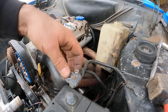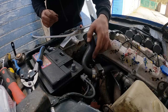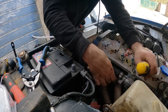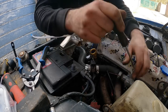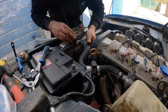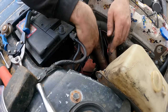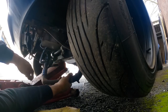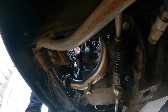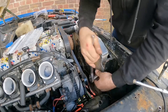Before actually bolting the radiator in, I wanted to double check that the fan was working correctly — which it was. I then wanted to trial fit the top and bottom hoses to work out how high I wanted to actually mount the radiator. The top hose was a little bit short, so I undid it at the water rail end, pulled it towards the radiator and done the jubilee clip back up — so that was fine. Here you can see the piece of hose I've been using as a reducer to make sure the top hose is tight on the radiator. Here I'm disconnecting the other end of the old bottom radiator hose from the water pump, and then I was able to pull the bottom radiator hose out of the way, though at this stage it was still connected to the hose running to the heater.